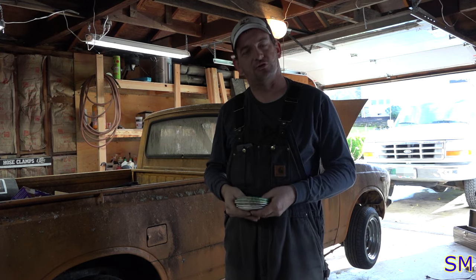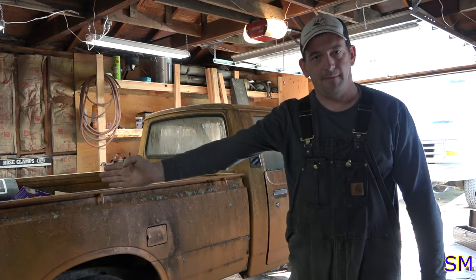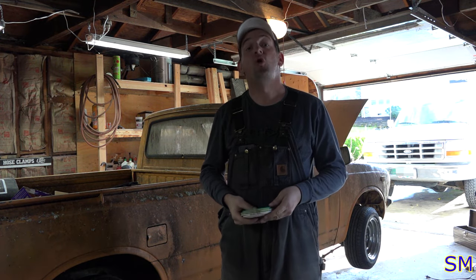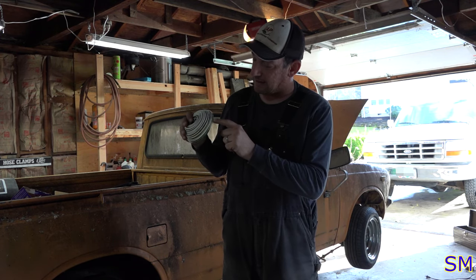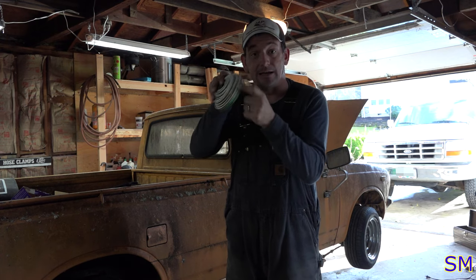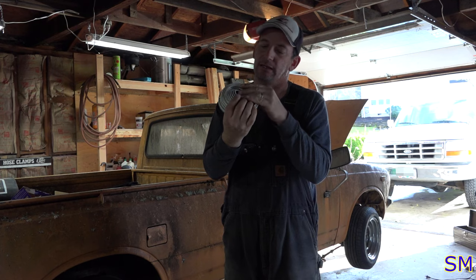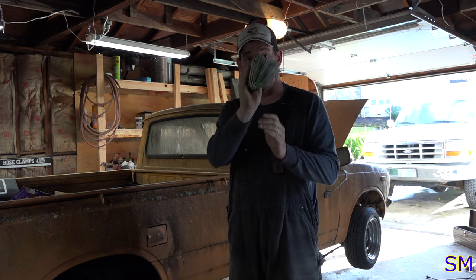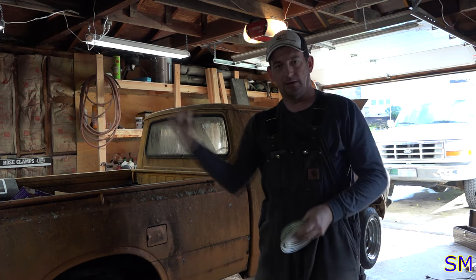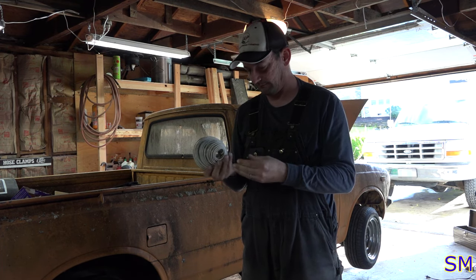And of course I still don't trust the wiring, so we're gonna run our own wiring from here over to here. And I was at the store spending money I don't have on this project. These wires say taillights on them. One of them trailer fancy kits. You got the 4-in-1 deal, you got the left turn, you get the right turn, you got the taillights, you need to ground. So what we're going to do is run trailer wire from the back to the front, or the front to the back, whichever one.